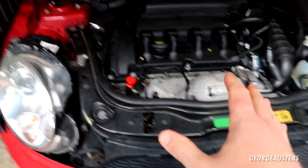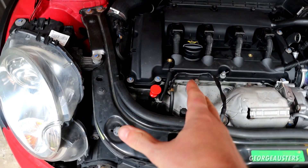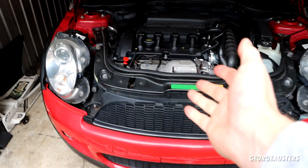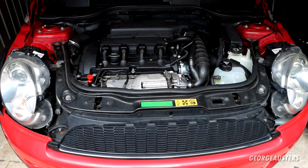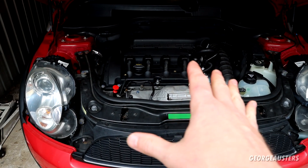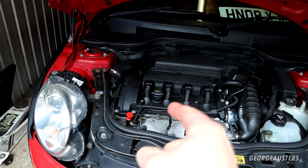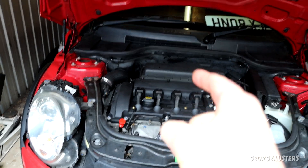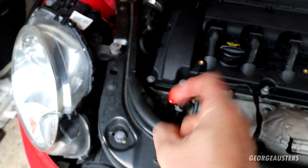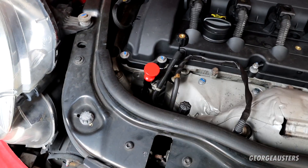You may think I'm going a bit over the top saying that swapping a dipstick out is a critical thing you must do. But when it comes to Mini Coopers - whether Mini Cooper S or just a base model - they are renowned for using oil. The worst thing you can do, and the thing that is going to ensure you have to rebuild your engine, is running low on oil. So it is very important to check your oil level at least on a weekly basis.